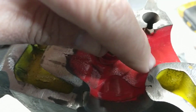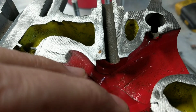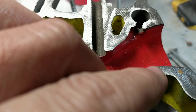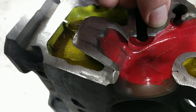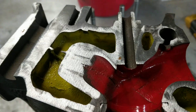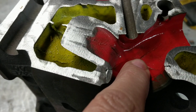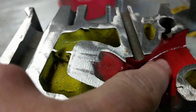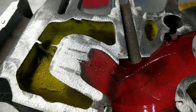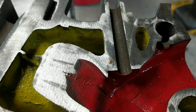And then you can drop the floor. Take a measurement from here to here between these two points before you start porting, and then take about 20 thousandths off the bottom of the floor here and another 20 thousandths up here — it'll really make a big difference. Just make a nice smooth curve all the way around. Get rid of any sharp edges. There's a little ridge right here you'll see when you start working on it — smooth that out. You can make the port a little wider, but don't make it taller. Just get on the floor a little bit right here, take a little bit out of that, and you'll be golden.